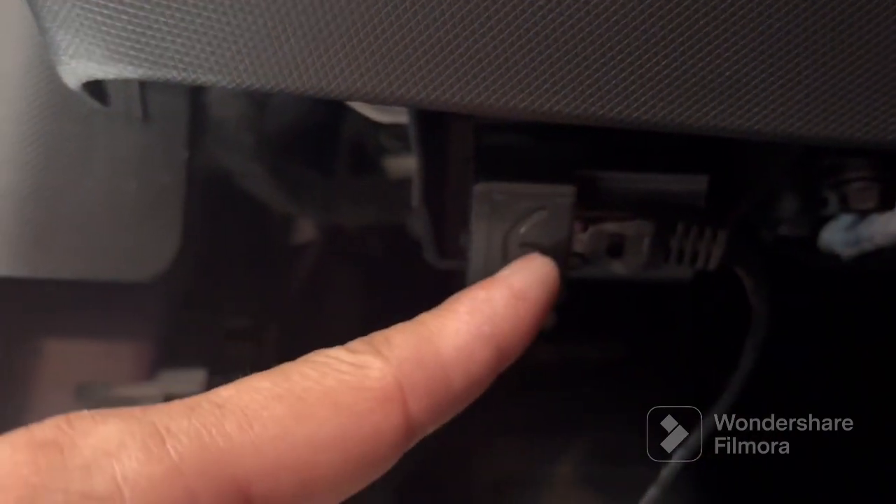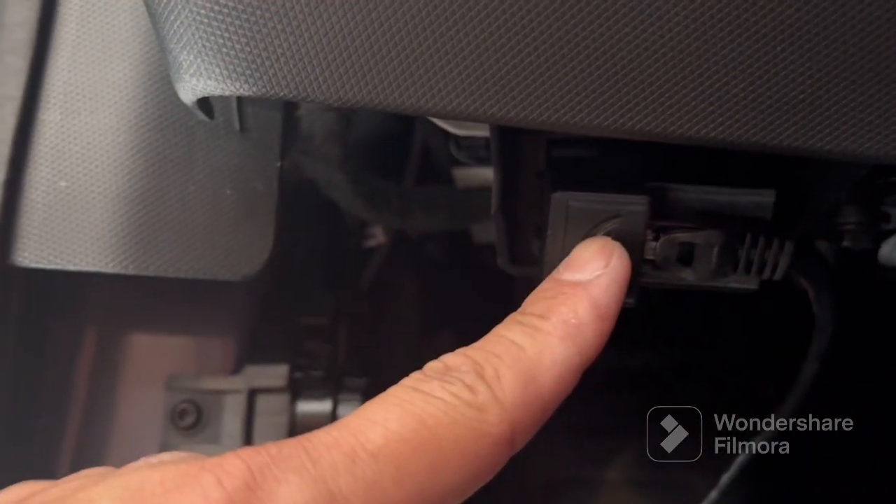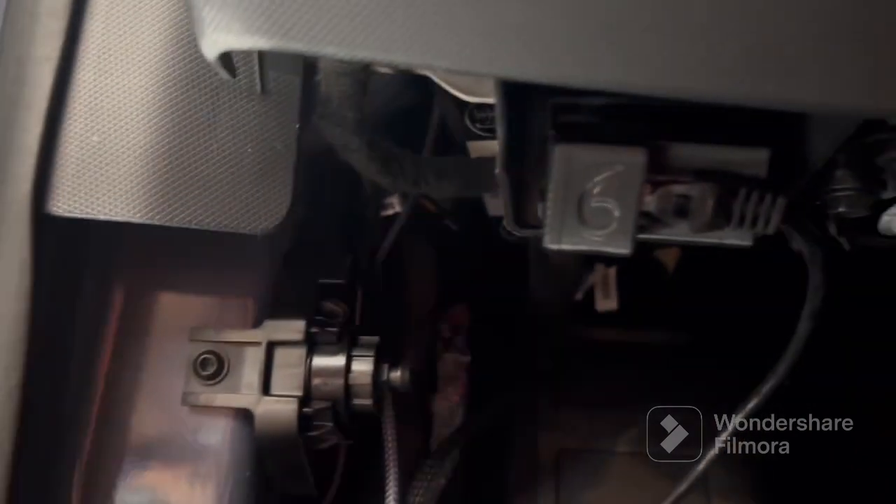This is the part where we had to use the USB extender — so this is one of two extenders. It's a 10-foot cable, and this right here I believe is another either three or six-foot — I'm pretty sure about six. So this then runs up, and the Cat5 connects to the OBD and the Comma unit for the OBD.